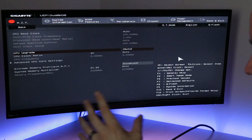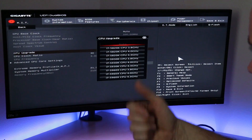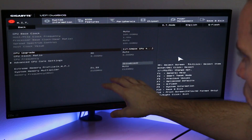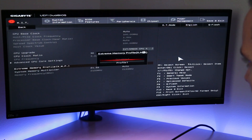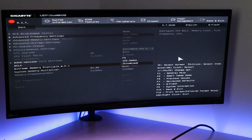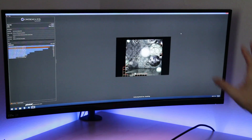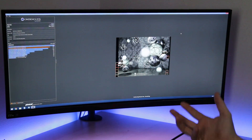In my motherboard's case right here, it's got a CPU upgrade dropdown and all three CPUs for X99 are represented: the 5820K, 5930K, and 5960X. It has three settings for each one: a 3.8, a 4.0, and a 4.3 one-touch overclock. I'm going to do the 4.3 and leave the memory at disabled and system memory multiplier at auto. Now remember, one of the reasons why I like Cinebench is it's just CPU — it doesn't take GPUs into account whatsoever, which some rendering applications would.